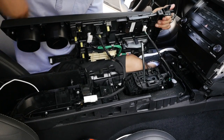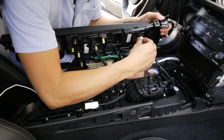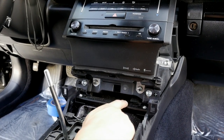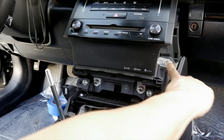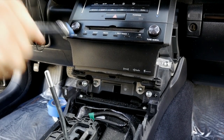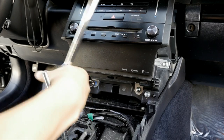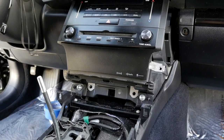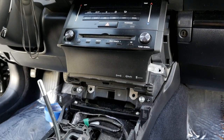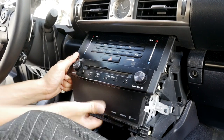After you remove the middle piece, there are three connectors that you need to disconnect. Next, remove the four 10mm bolts using your 10mm socket wrench, turning counterclockwise one by one. Before you remove the head unit, grab a big blanket and set it here so that we don't scratch the radio. Then grab a hold of the radio and gently pull it towards you.